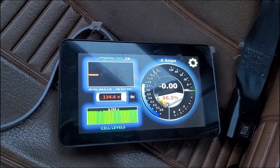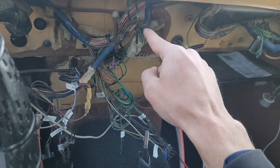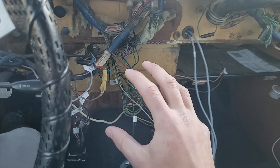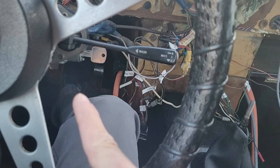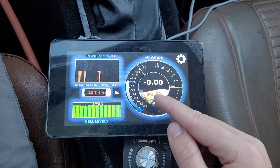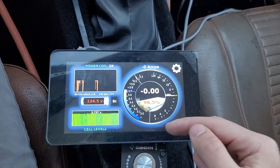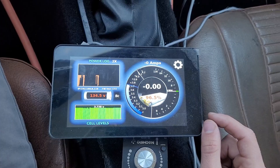We'll get there when we get there — I'm going to have to design a cooling system. Next steps: get a better module 2 in there — which I put on top underneath the hood because I expected this — figure out all the wiring, get headlights and turn signals working, get the brakes working better, set charge temperature and cutoff parameters, and calibrate state of charge percentage. This is a huge milestone. I'm really excited to be able to drive this car around — it's already super fun. Now I can drive it and do continuous improvement updates.